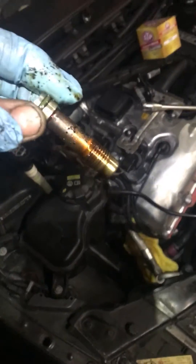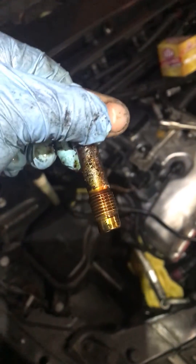Kind of hard to see, but there's two holes right there. Here they are. For you guys working on these N-style motors, make sure if they have these valves that you check them and clean them.